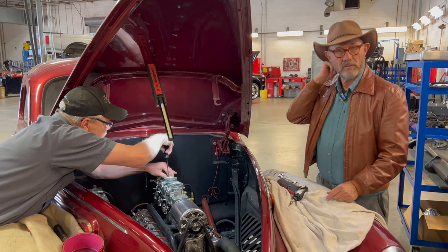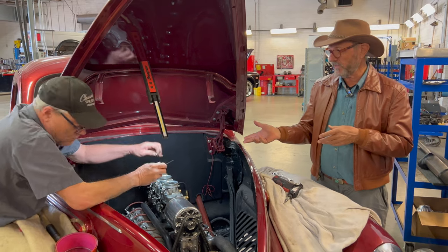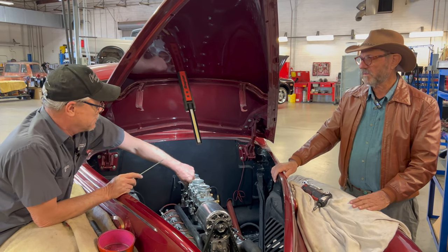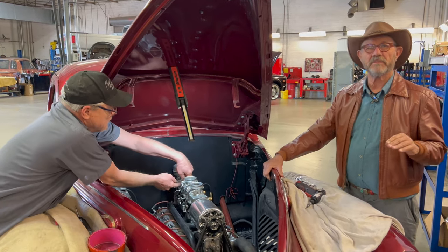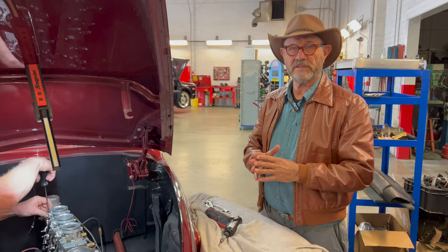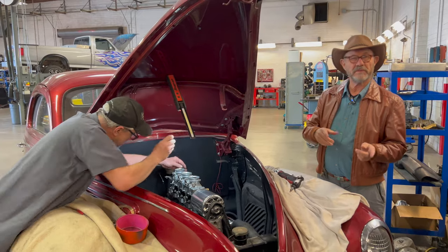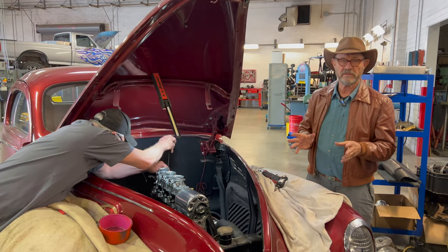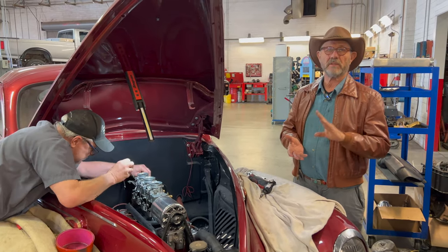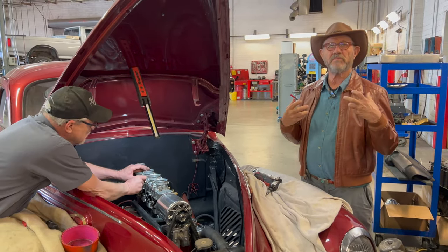Well, it turns out that when he opened up the carburetor, the diaphragms are leather. That's a little bit unusual. Is that true, Dave? It's unusual for anything newer, but all the older carburetors would use leather accelerator pumps. Okay, so it's a thin leather accelerator pump, very long lasting, but it must be kept moist. Mm-hmm. There are different kinds of diaphragms in carburetors. Now, this old style carburetor, these are new carburetors, remember, but they're built in the old style because of the appearance. So there's a couple of different ways you can do that. You can put rubber diaphragms in there, you can put leather diaphragms in there. The old carburetors, a lot of them at least, had leather diaphragms, so that could be reconditioned.